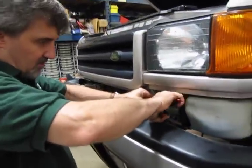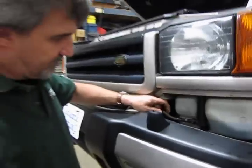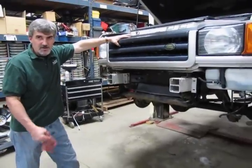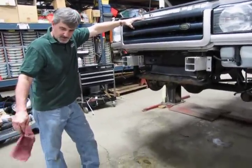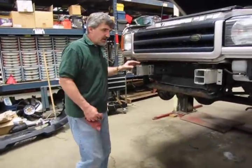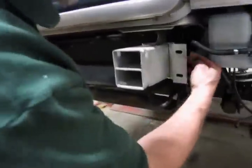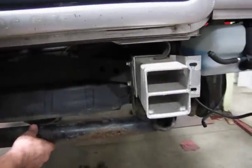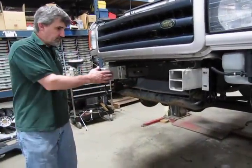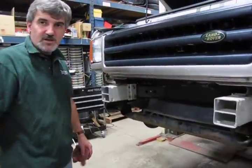We'll pinch the hose, run the bolt in, and clamp it in place. As you can see, the bumper's off and it really didn't take that long. Looking at the new bumper, it doesn't have the two studs down each side like the original. The next step is to remove these horns — they're held in by two through-bolts that also hold the bottom support rod. Once we install the new bumper, we won't need the bottom rod or the horns. The bumper will mount directly onto the frame rails using the existing bolts we just took off the front horns.